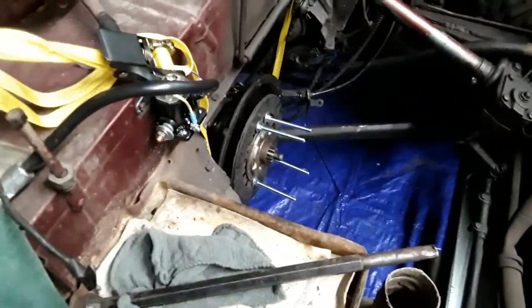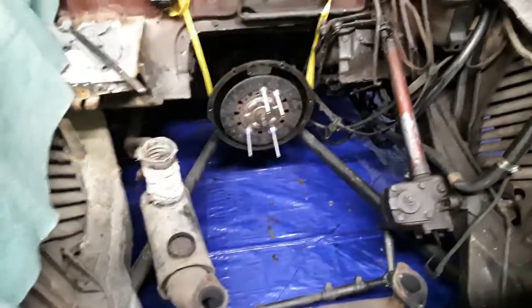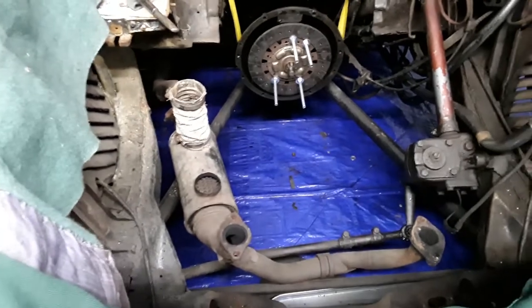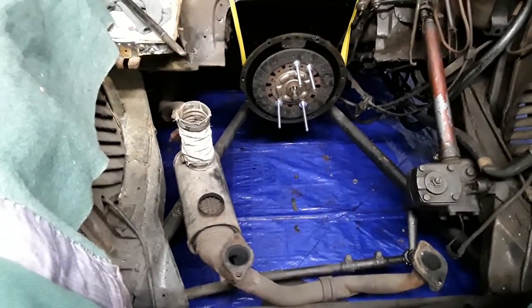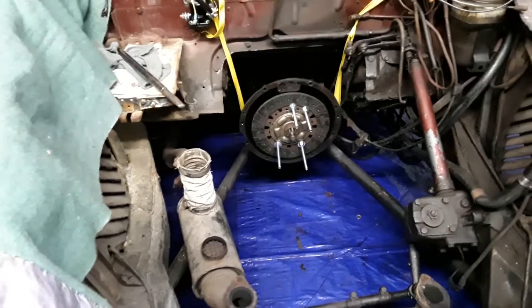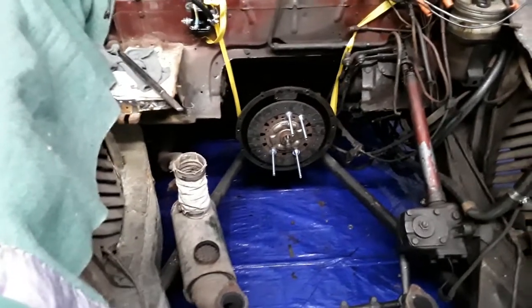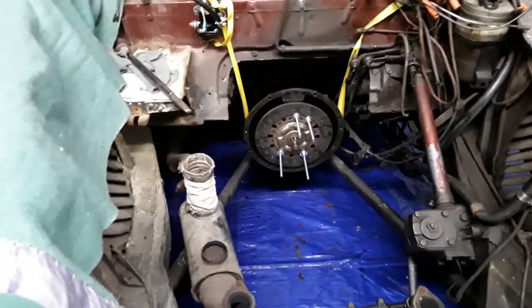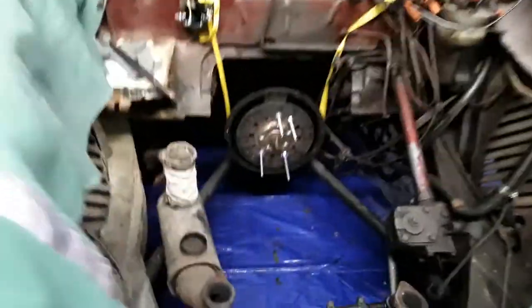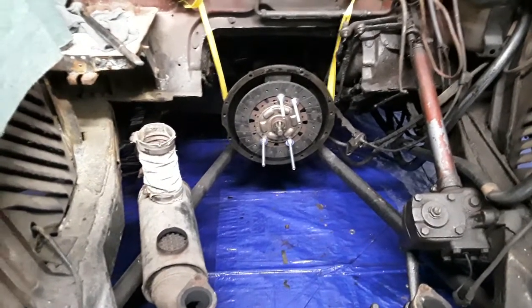My problem is apparently now in the transmission. After I jacked the car up and had a friend come over and help me, I could observe the driveshaft inside the torque tube through the speedometer gear port. I shook it back and forth and the rear axle seems to have about the right amount of free play in the gear set — you can hear it taking up slack just barely — and the driveshaft movement is within what I would consider a somewhat normal amount of free play in the axle.